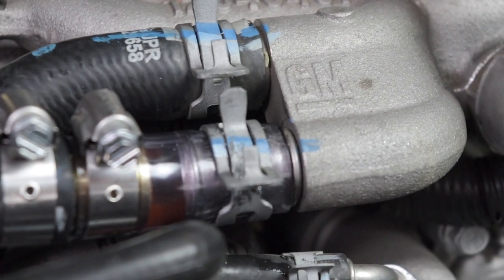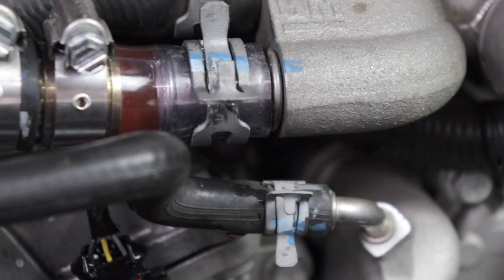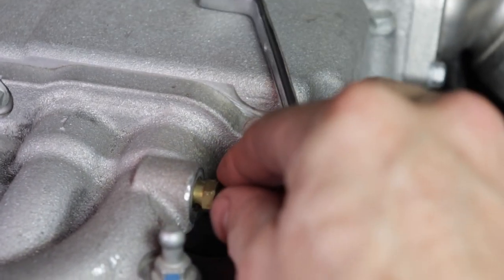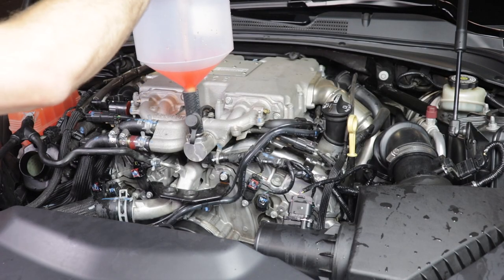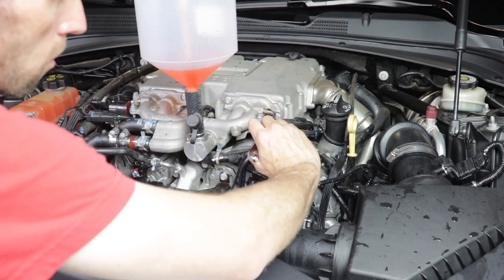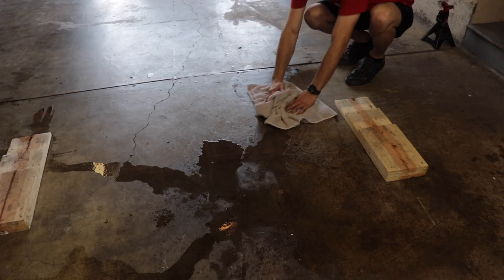Having the clear hose section was definitely helpful in seeing that the coolant was there and spotting an air pocket in that spot. In addition, you may be able to get some more air out by cracking open the bleeders with a 7mm wrench — these are located on the sides of the inlet. When you crack it open, some air will come out and then it will start leaking coolant; close them when they start leaking fluid. Keep working at it — you might spend 15 or 20 minutes. After you think you've gotten most of the bubbles out, take the car out for a drive, get it warmed up, and come back and do it some more. Be sure to wipe up and rinse away any spilled coolant.